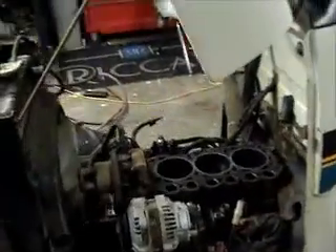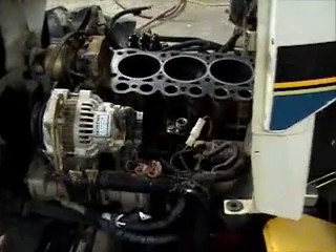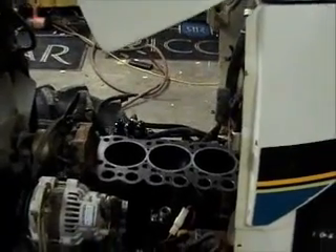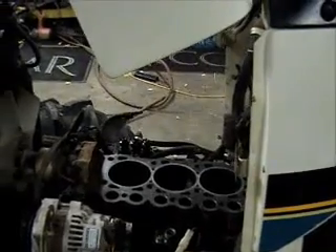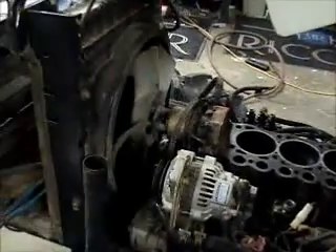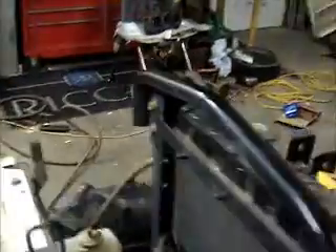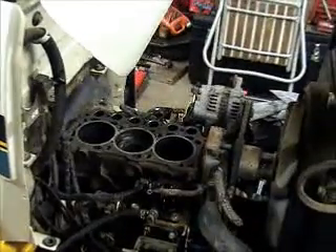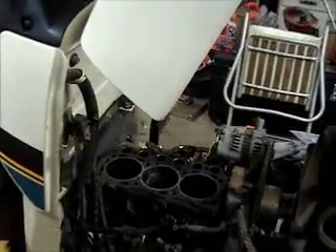So that's where I'm at — the head's off. I'm probably going to knock off for the night and get back out here tomorrow and finish this thing up, and I'll get more videos. I'll go ahead and upload this one. This is a Mitsubishi K3G three-cylinder diesel. Tomorrow I'll get video with the oil pan off — first I'll get the front end jacked up, center pan out, oil pan drop, get the rods out, and everything else. Then we'll start the series of reinstalling and putting everything back together. If you're not subscribed, subscribe, rate my videos, comment and let me know what y'all think. Y'all have a good one, bye.